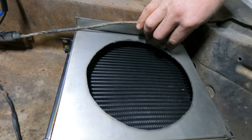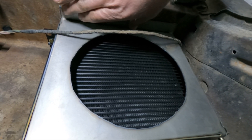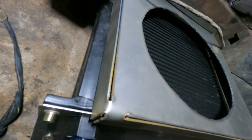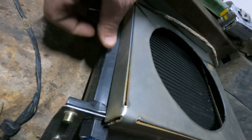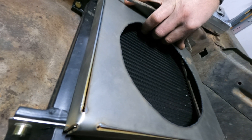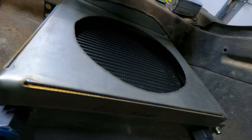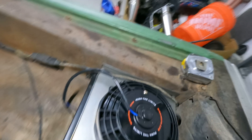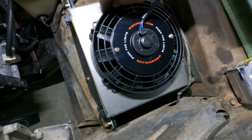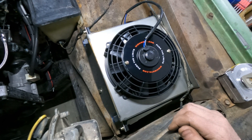The wiring harness still fits decent. All I'm going to do to attach this is put a couple of bolts here and here, use some rivet nuts in the inner fender to secure this flange, and then get some rubber fuel hose, cut it to length, fillet it open, and put it on this edge to keep it from wearing holes in the cooler and to fill the gap. That rubber hose will keep it sitting down on the cooler and keep it from vibrating too much. I forgot to put the hole in it but cut one real quick and this thing fits on there real nice — it moves a ton of air and it's fairly quiet for only an 8-inch fan.